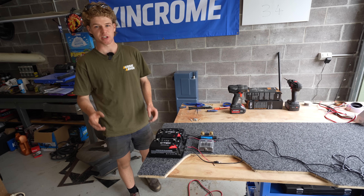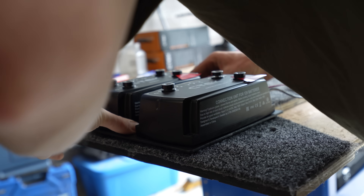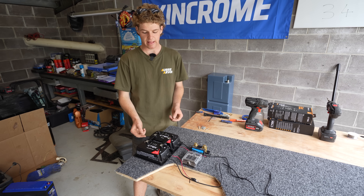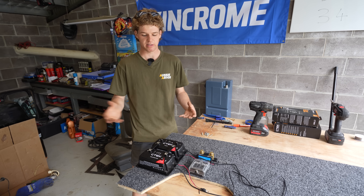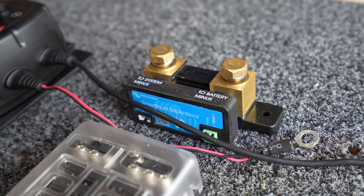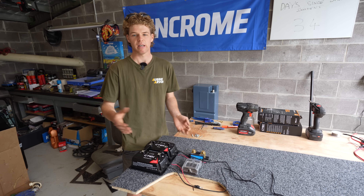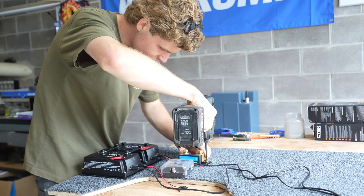I pulled the board back out and was messing around with where all the electronic components are best going to fit, because it is quite tight in there with the seat pressed up against the back of the cab. The CTEK chargers are positioned on the side, sort of behind the driver's seat, shifted up from the bottom of the cab so they're not prone to any water ingress. When you use them in conjunction, the kit comes with a set of bus bars, making sure it's all neatly and securely joined together. I've also placed the SmartShunt next to the negative terminal on the charger, so everything running through the system goes through the shunt for a correct reading on my phone. The inline fuse holder is positioned in a nice neat spot where I can run short cables to it.